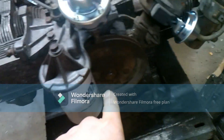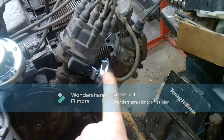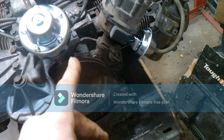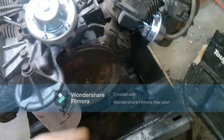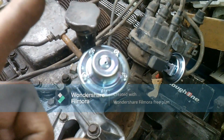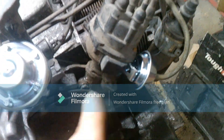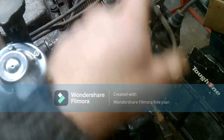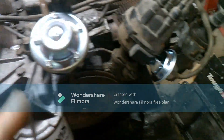The crank spins counterclockwise, but the distributor spins clockwise. I don't know why it's opposite — I think it's because it's gear drive. It doesn't have a timing chain; it's got a gear on the crank and a gear on the cam, so that's probably why it spins opposite. Anyway, I'm gonna get set up here and put my compression tester on number one, which is right here. If this was sitting in the car, this would be the passenger side — which is a little confusing — but this is the front of the engine. Cylinder order is one, three, five and two, four, six. We're gonna start with number one.